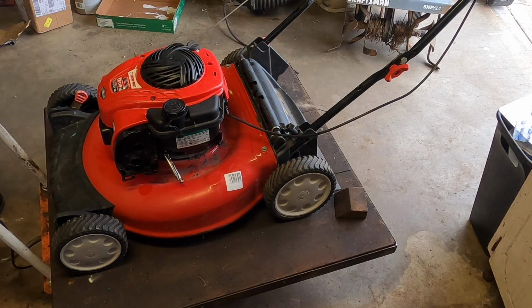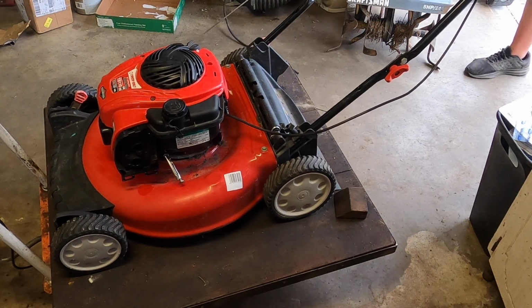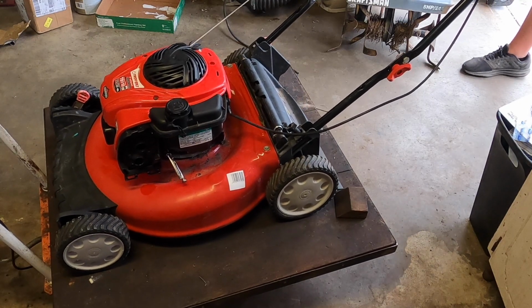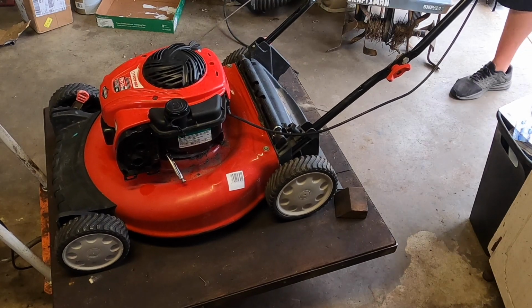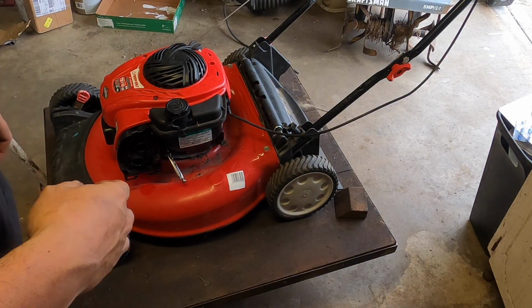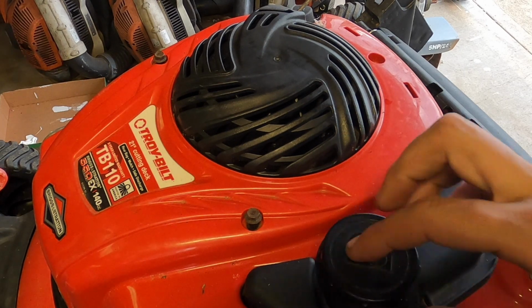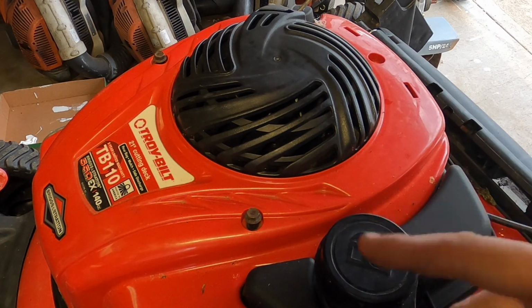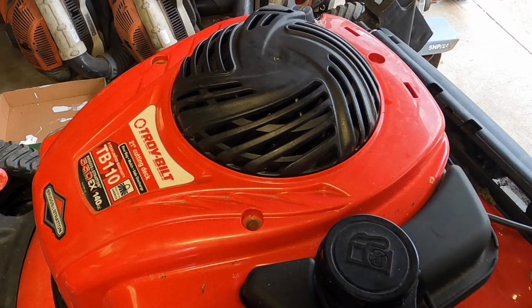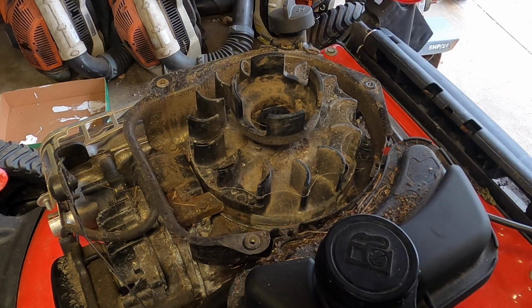Got stuck. Well, I think we fixed one problem just to make another one worse. So the good news and bad news? The good news is I heard a small hissing, and it's coming from the tank, and as soon as I took off the lid, the carb stopped leaking when I took off the clamps, so I think the tank is pressurized, which isn't good. Just means we need a new lid though, but interesting. Okay, there's no crawlers in there.